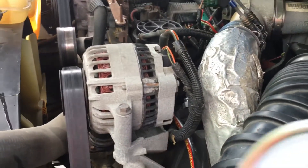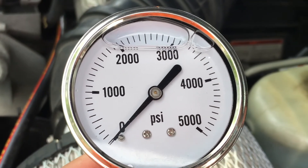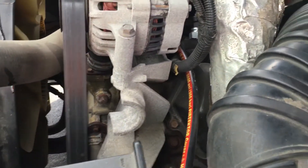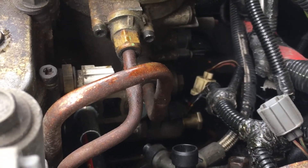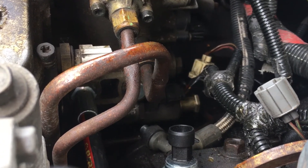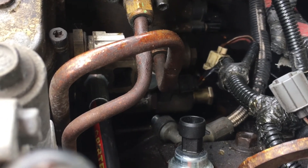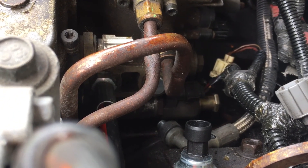That was 1,500-1,600 PSI. I assume my high pressure oil pump is going out on my truck, or it is out, or my IPR is going out. I've searched the internet and I cannot find anything on what my pressure should be while cranking the motor during this deadhead test. So if anybody's got any info, that would be awesome.